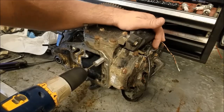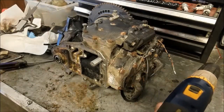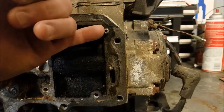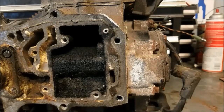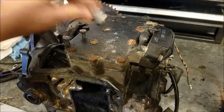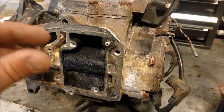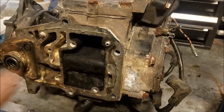Keep in mind, one of the problems here is if you're doing this by hand, good luck keeping it centered. But I don't think this should be an issue — I think we can drill now. And that is not easy, but it's looking pretty good so far. That is the center — that's working quite well. I've just broken through the bolt. Every now and then I would stop and clean out the chips. It was pretty easy to feel when it hit the end of the bolt — it just went in a little bit and then stopped. So we now have a 7/64ths hole in the center all the way through that bolt.